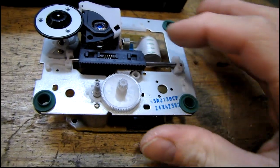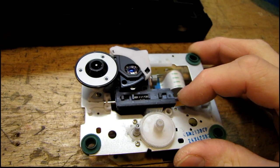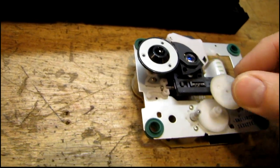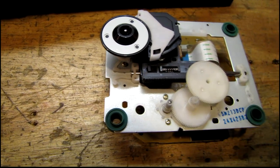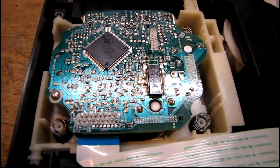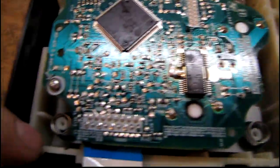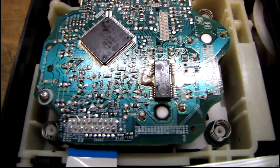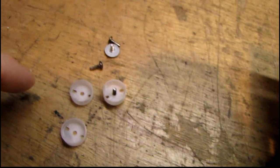Before putting the drive gear back in, I'll show you how that shutter works. When it's not playing and goes back to home position, it slides a cover over the lens to keep it clean. Going ahead and snapping the gear back in place — this is how the CD player sits when it's idle. Now putting this assembly back in: you set the player assembly back into the plastic cradle. It's got green rubber mounts that it rides on — just slide it back down so the rubber mounts go over the posts without getting folded over.